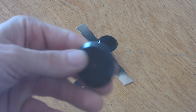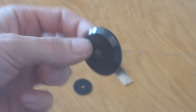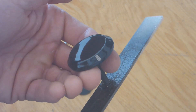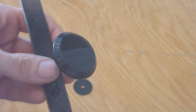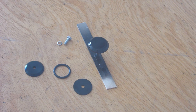The only thing to be aware of is that anodized finishes, which is pretty common on these types of materials, don't hold up to UV very well. So what I did was I painted this the body color black — you can see that this is a painted surface, which is just going to hold up against the sun. This is probably an unnecessary step for most people, but it is absolutely necessary for anyone who lives in Florida. I'll have some information about this product in the video description.